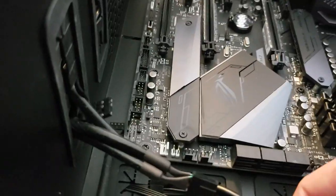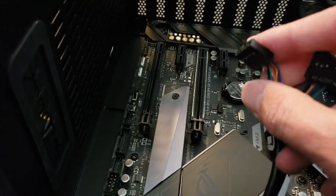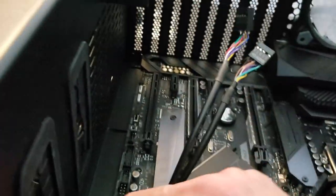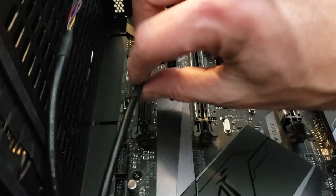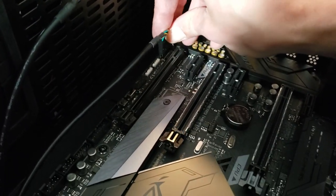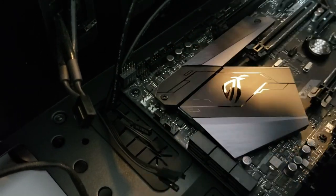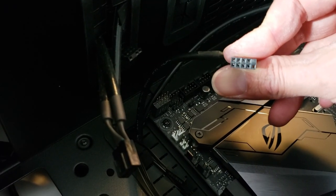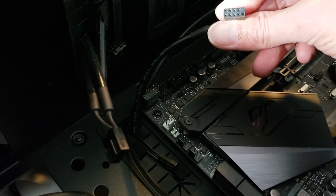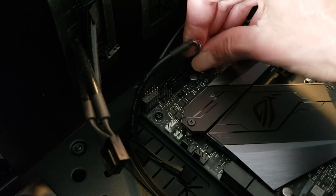We also have HD audio and a USB cable. These are routed down below the motherboard. HD audio is always at the far end, lower left-hand corner. For USB 2.0, I find the USB 2.0 headers and make sure the pins are aligned correctly — there are nine holes that need to fit up with nine pins.